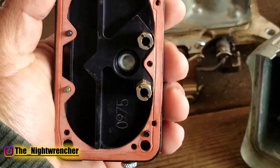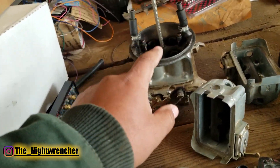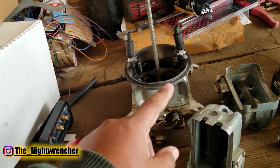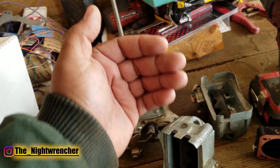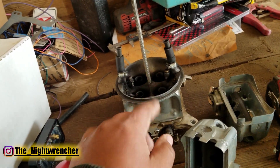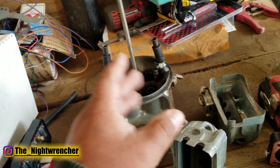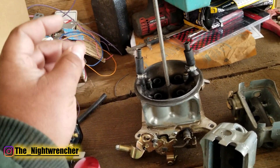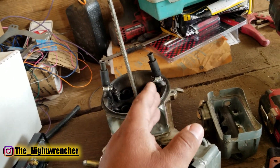I'm running really large jets on the secondary side. The reason I needed that is because since I don't have a second power valve and I was needing more fuel, I was reading the plugs on the corners and the backside was leaning out a little bit. So I drilled out the jets to get that extra fuel needed to balance things out. I'm running like 150 thousandths in the rear — it's not really a jet size anymore, it's 150 thousandths. And I'm running stock jetting with the boost-activated power valve in the front. If I was running power valves front and rear, I wouldn't have to go so high on the jetting in the rear.